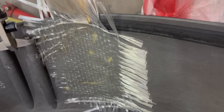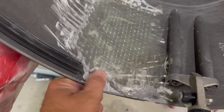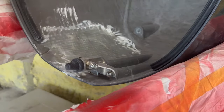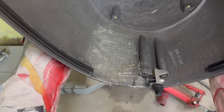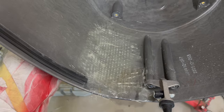It's already starting to set up — that's pretty much it. Here's where we're at in this stage of repair. You can see the crack through there, we've got it covered pretty good, I'm happy with this. Now we're just going to let this sit overnight. We can always trim up some of this stuff after the fact. I took the wood off that was holding this together — now this thing is secured. I'm going to go back and add a little more right here and kind of feather these out with the fiberglass. That's the back side repair — now we're going to flip it over and show you how to do the front side.